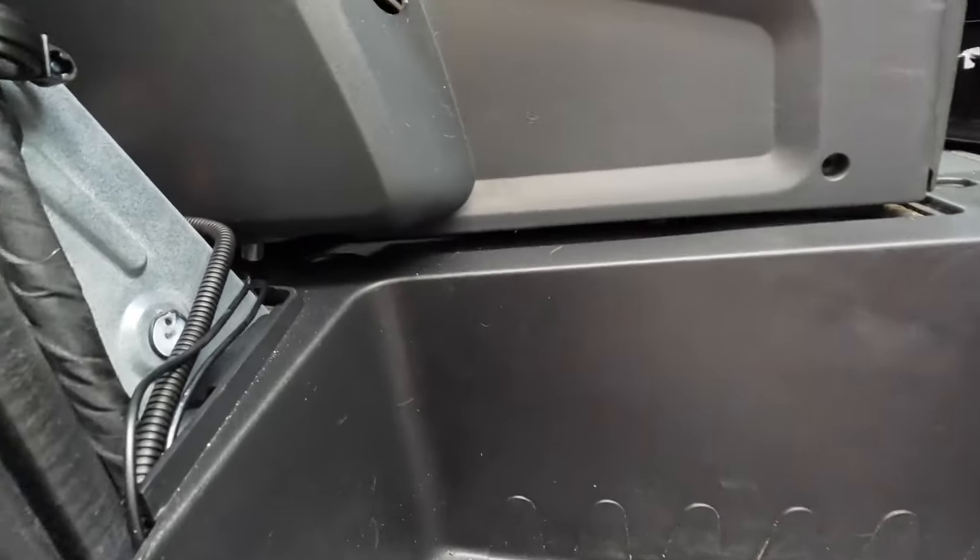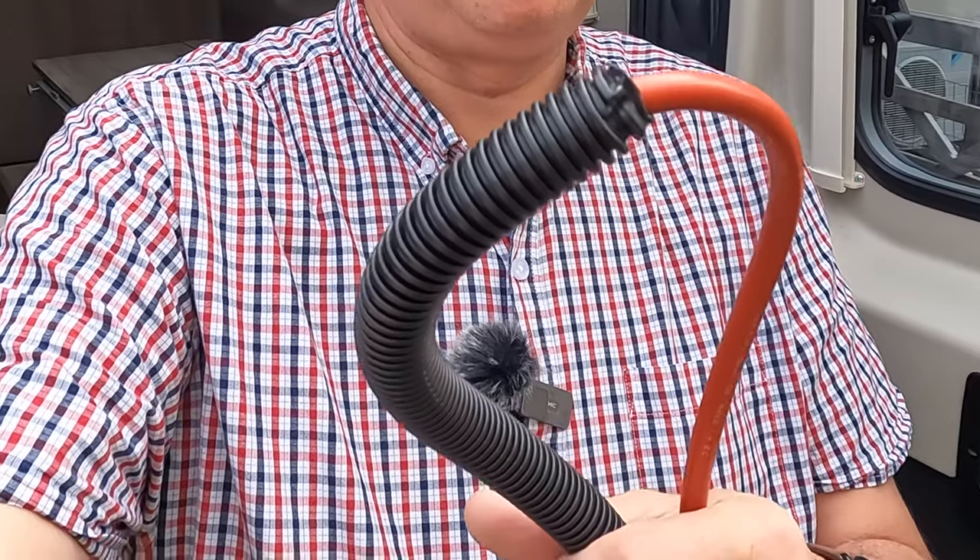My plan is to connect a new wire from the vehicle battery and run it underneath, because I've looked at routing internally and it's going to be a pain. I don't particularly like running cables under the floor where you're walking because you tend to get unseen wear and that can lead to trouble. So I'm going to run it underneath, tucked well out of the way, and put the cable in some conduit for extra protection from the elements so it doesn't deteriorate over time.